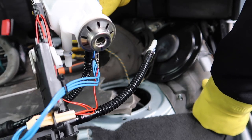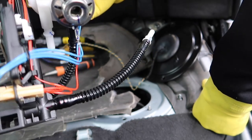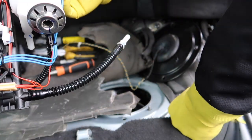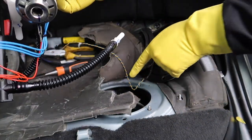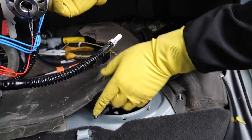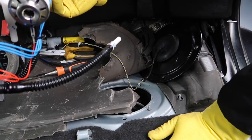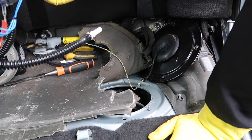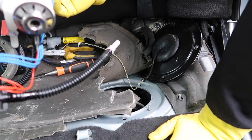So if you're getting a low pressure code, or when you're hitting the rev limiter you're getting reduced power, this will be the reason why. This is what a lot of people end up misdiagnosing — they forget that the pressure regulator actually sits in here as well. You do want to do this while your fuel is low. I've done this with only about 10 miles left in the tank — the fuel is very empty. You don't want to be doing this with a full tank, so just be aware of that.